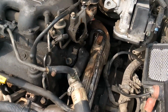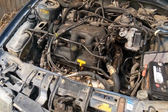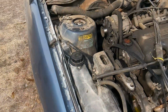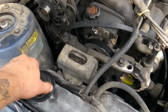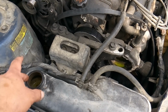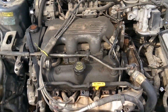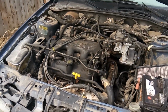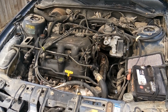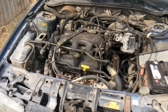And then also, while I have the thermostats out, I'm going to go ahead and show you how I test them. Now, somebody had mentioned that what you could do when you're doing diagnosis is you can put a balloon over your reservoir, or you can do a pressure test to see if a head gasket is blown on it. The only catch with going straight to a pressure test before you've been through a cooling system is, when it comes to a pressurized system like the cooling system, it's only as strong as its weakest link.